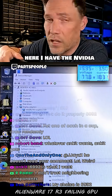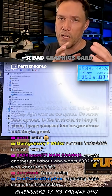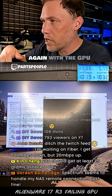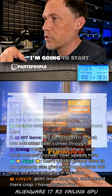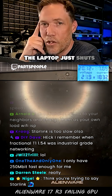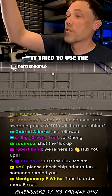You can see the NVIDIA graphics card is disabled. This is how you can identify if you have a bad graphics card or graphics power MOSFETs that power the card. So now we have it enabled — I'm gonna open FurMark again with the GPU enabled. Three, two, one. That was it. The laptop just shuts off. The laptop was running fine until it tried to use the GPU.